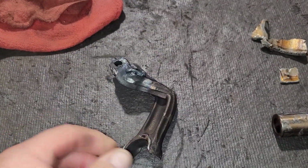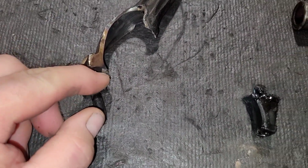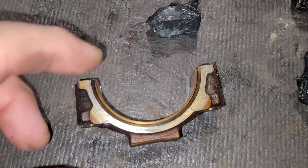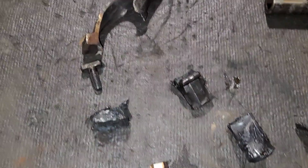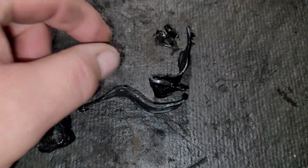That's what's left of the connecting rod. Here's part of the rod bolt that's supposed to come through a piece that's hanging down here, an ear that's hanging off. And here's what's left of the cap. Here's a cap off the one next to it. But as you see how dark in color this is? I mean, it's burned up. What happened more than likely was it probably spun that bearing for whatever reason. And here's what's left of the bearing.